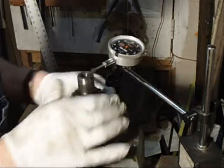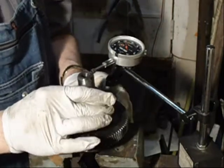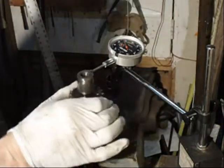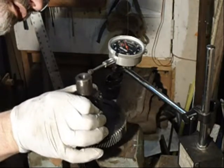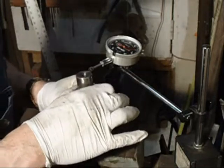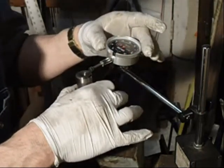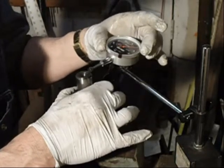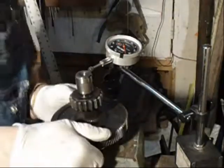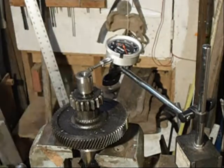Sometimes you get these — the movement is concentrated right in one spot. But if I change the location, it'll be a little bit tighter. It's kind of weird; I don't really understand why that is. Rotating about 90 degrees, another measurement is only about .020, getting up to about .025. Now it's moving .040, .045. I guess it's a bad bearing — that much movement. But who knows how long it would have lasted in the car; it would have lasted a long time.